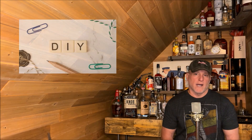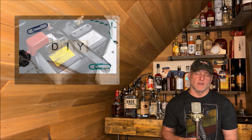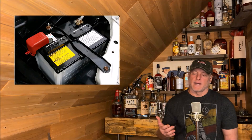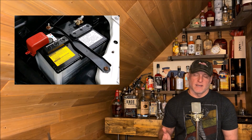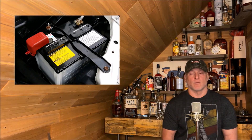Hello, Driving Tells community. Most of you that follow my channel are DIYers, and one of the most basic things that you can do is replace the battery of your vehicle. Well, as time moves on, things get much more complicated. A lot of vehicles have settings retained in memory, and when you remove the battery, if you remove it for more than just a few minutes, the capacitor is discharged and your vehicle forgets a lot of stuff.